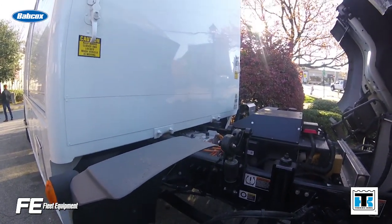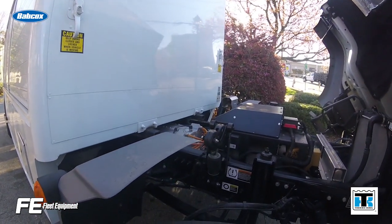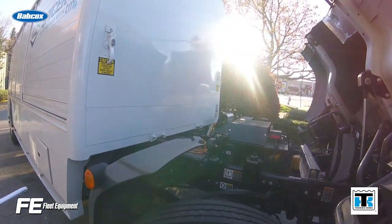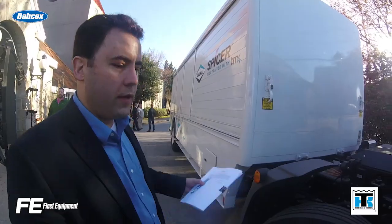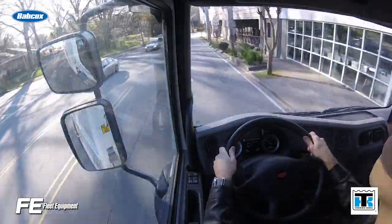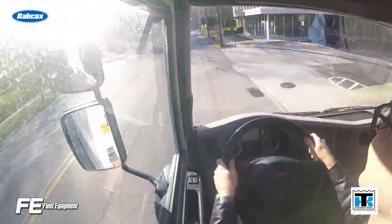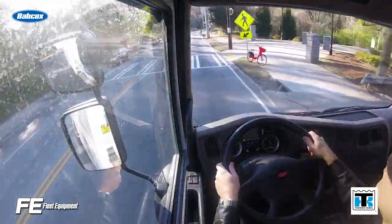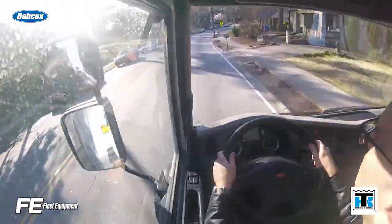Is there an advantage to having both an electrified axle and a motor, or do you have to choose one or the other? It's really about customer preferences. With a central direct drive approach, these are available now — they're production-validated solutions that work in existing chassis and are very easy to upfit. The e-axles will offer additional benefits as those become production available, giving additional packaging space for batteries or any configuration sidesteps on the vehicles. We're talking about a step van, so those will offer additional advantages as well. So they're both great solutions — a lot of it is timing as well as vehicle configuration.